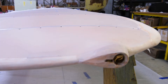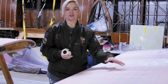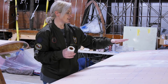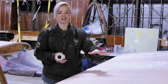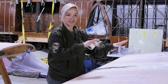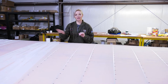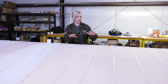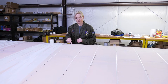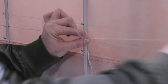Along the tip it's all glued down but the fabric is still loose at that point. We go over it with 250 degrees with an iron and evenly tighten the fabric out on both sides. Then we go over it with 350 degrees for its final tightness. After it's tight, we put a coat of poly brush over the entire surface — it's a type of glue — and then it's ready to rib stitch. We mark it out, put our reinforcing tape down, and do the rib stitch.